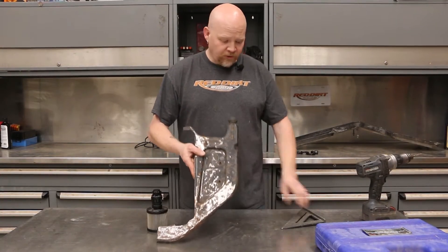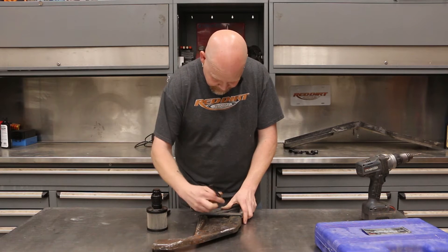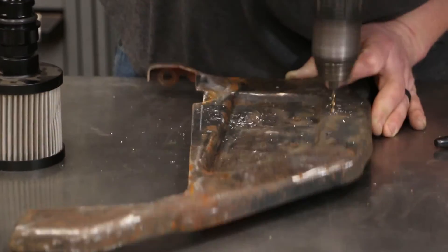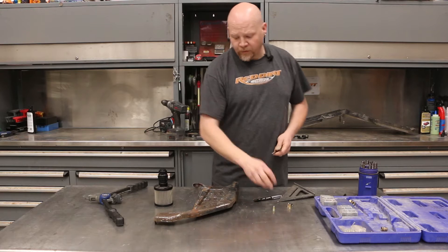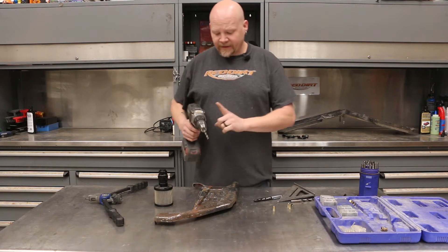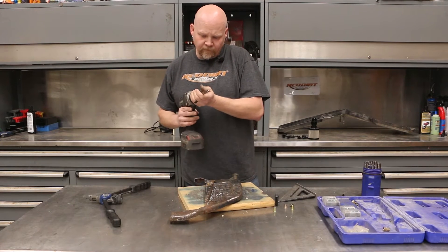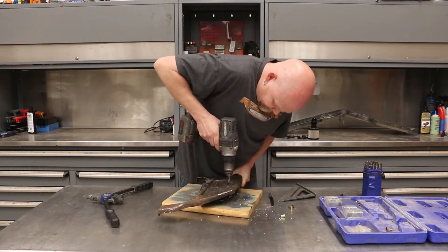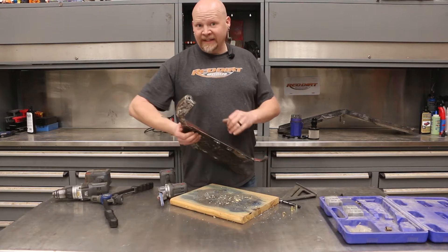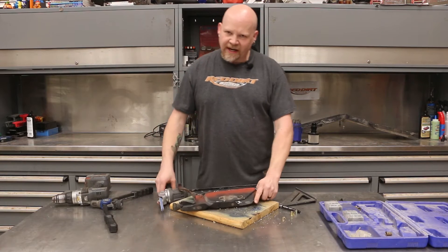I already know this is fully vertical. I'll put our straight edge up against it — we're maybe a sixteenth of an inch off — and re-mark right on the center. I'm going to drill this out and install some riv nuts to make this clean. We're going to install some quarter-twenty riv nuts, which means I need to open these up to three-eighths of an inch in a couple of stages. I've already drilled it with an eighth-inch pilot and now we're going to drill it out with five-sixteenths. In order to make the intercooler fit, I had to section a big chunk of this out, which means I added a brace right here. I need to dress those welds down so the riv nuts fit.